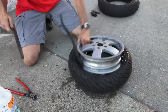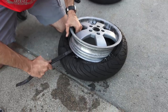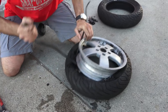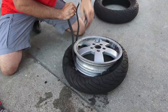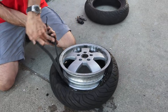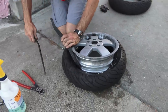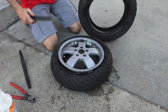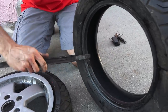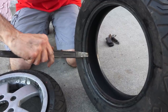There's a little bit of technique to this and you just have to do it to kind of master it. By no means am I like a pro — it's not something I do every day. I'm not a tire shop that has no tire machine; I have a tire machine at the shop, so of course I'm never going to do this at the shop. This might be the first time I've ever changed a tubeless tire at my current shop with just basic tools — it's something I would do on the side of the road in the middle of nowhere. I'm using my forearm just to keep that tire iron from flinging back when I get the next tire iron in. Even this is a dangerous job because sometimes the tire irons will fling around. The last little bit is where it gets a little difficult sometimes. Just get that little spoon edge on the bead of the tire — if you have too much of the tire iron, it's too thick and the leverage doesn't work.